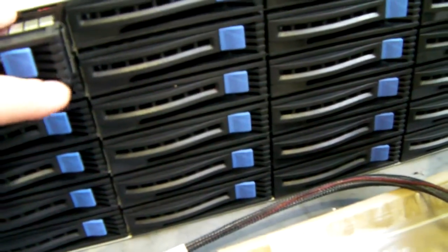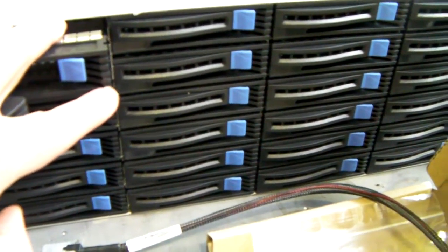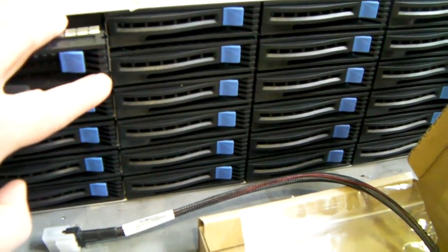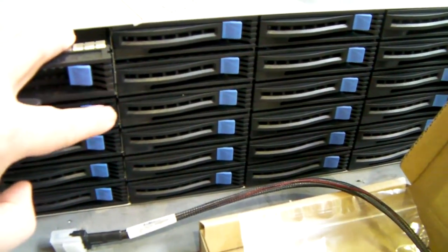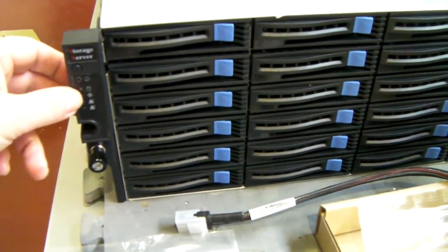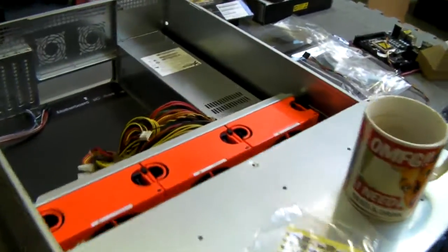Each of the caddies has got two lights on it. Depending on what RAID card or HBA card you use, they have different functions, but as a rule the blue one at the bottom will stay on constantly and the amber one at the top — depending how you set the jumpers — will flicker either if your drives have got a problem or with drive activity. If you're not using SGPIO, the chassis front has just your standard lights for power on, LAN, and hard drive activity, which will just be for your operating system drives internally.